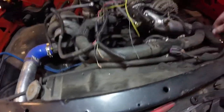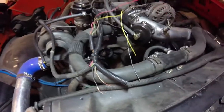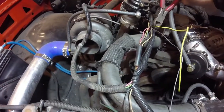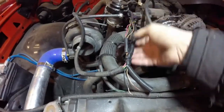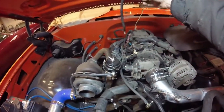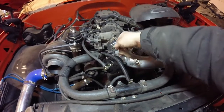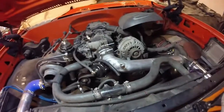So we got the harness trimmed off — we won't need this much of the harness anymore. These two wires are sticking up here; the ones that are left from the sensor, we'll just trim them off to get them out and leave them back in the harness because we don't need them. I'll put the conduit back onto it and continue to join this up, routing the conduit width under the intake and back through this area. We'll shorten it up some more. We got some heat shrink put on and rolled back on the wires here, so we'll just solder these up now and put the heat shrink on it, and that'll take care of that connection.